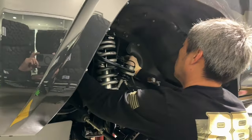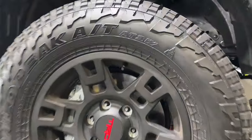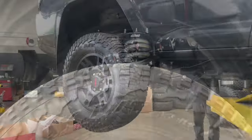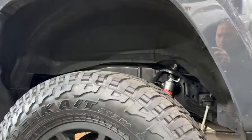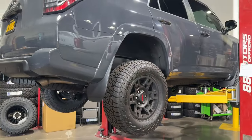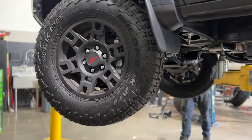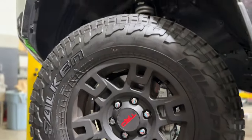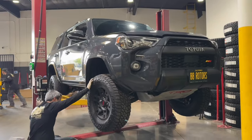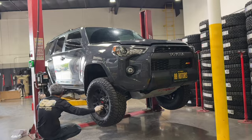We also adjust the coilovers properly and get them set up the same way we set them up on the vehicles in our videos. If you need a lift package for your vehicle, check out our website at 88RotorsOffRoad.com. Our ICON Stage 2R kits can come complete with the same options so you can install them the same day you get them without needing a spring compressor. With this setup installed we're able to clear 285/70R17 tires, but the customer is keeping his TRD Pro wheels with the 265/70R17 KO2s he came in with.